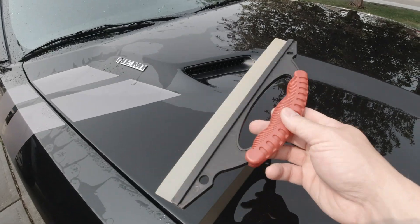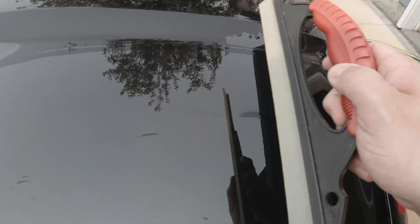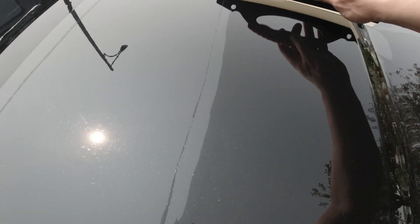After you've done your first pass — washing a section of the car with the soap and the mitt and then rinsing that soap off — the next thing is you want to dry it right away before all that water gets a chance to dry on its own and leave water spots everywhere. You're going to want to use some microfiber towels. These are great, they absorb a lot of water and they're not going to hurt your paint. Make sure they're clean with no dirt before you start. With my water blade, nice and gently, I'm just going to sweep that water across — that rubber is not going to hurt your paint, but it gets a big streak of water off there so you have much less to dry with your microfiber towels.